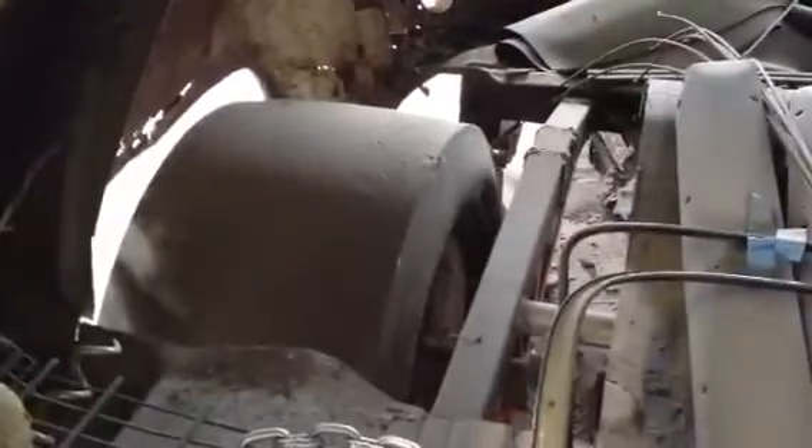Going to have to do the same thing on that corner. Not much to do there, not much to do. No body work on the trunk — it's already primered up, actually. I did that the other day, sanded it all down and primered it. Hinges are fine, a little creaky, but a little oil took care of it. The back end is tubbed — we're going to have to get some sheet metal and tub that in.